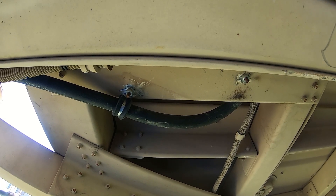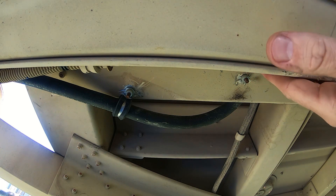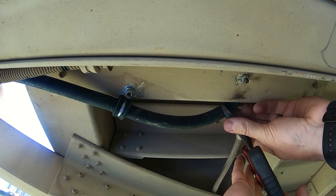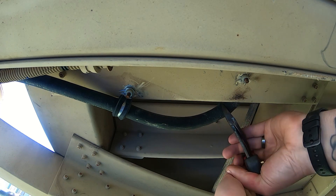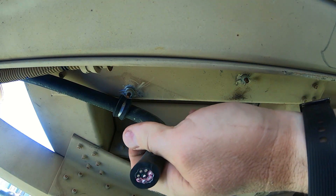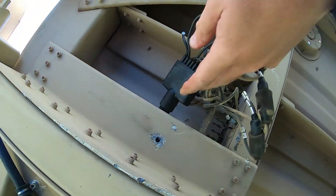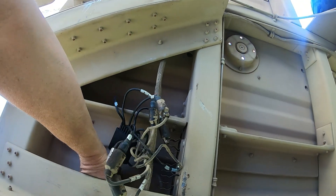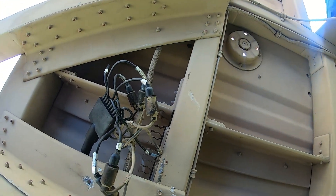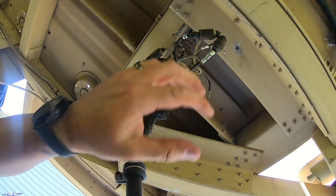This is the incoming side. I don't want to cut off the big connector because some of the diagrams do have that in there, but I definitely need to get rid of this wire. I couldn't get it on the backside from the angle, so I'm just going to go ahead and snip here so I can pull out that direction and pull out the other direction. I know this will probably hurt some of you guys because you want this wire, but for what I'm doing it needs to go so I can get in my 7-pin. So there's a nice large cut. You can see all your wires on the inside, and now I can pull that one through here. I can test one of these and line them up with the actual wire color codes that I need. I'm going to leave this side so I can connect up and do these one at a time.